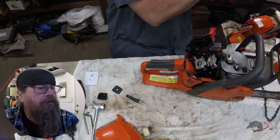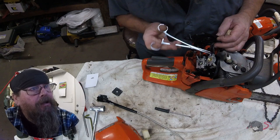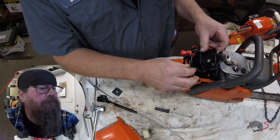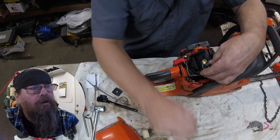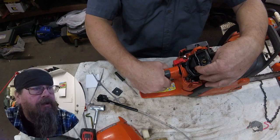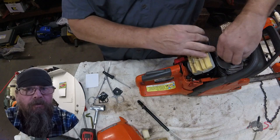There's still 4 minutes left in this video so maybe it'll run, maybe it won't. We're going to pop our last fuel line on here and then get our air filter holder back in place. I'm speeding this up a little bit, but one thing I want you to remember is that these 4 screws holding this on and holding the carburetor on are just going into plastic — so you can see I did the final torque by hand. Then we do a little function check and make sure the throttle linkage, choke linkage, fast idle, and kickdown with the trigger are all working properly before we try and start it.